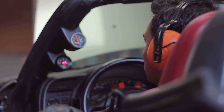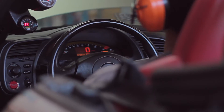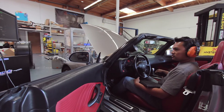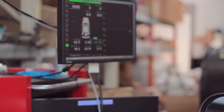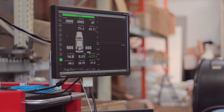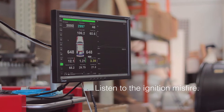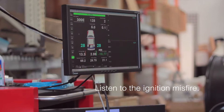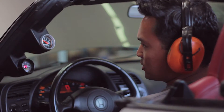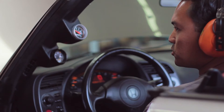There's too much exhaust flow for it. See what it does when you stick the thing under load a little bit. Try it at 3 grand. It's making more power than it did before, so now it's out of tune. It's making too much cylinder — ultimately, power comes down to cylinder pressure.